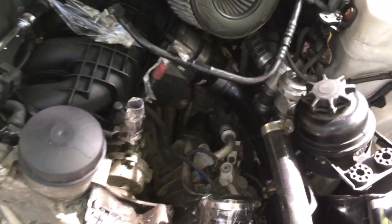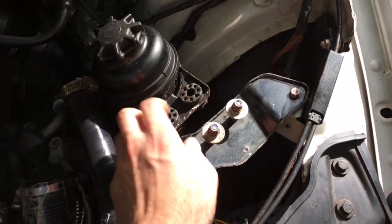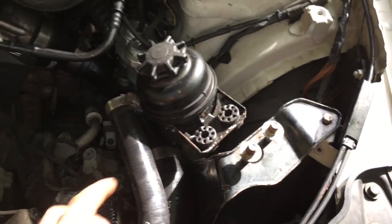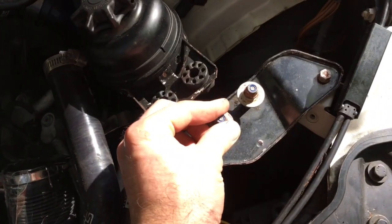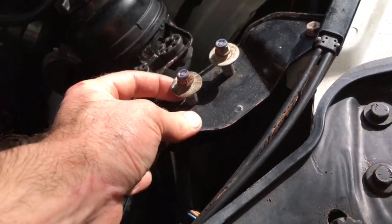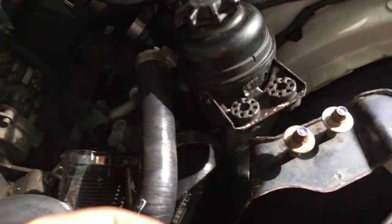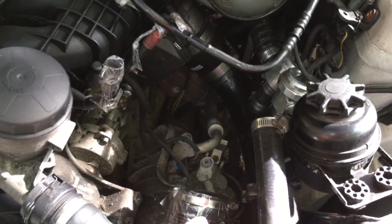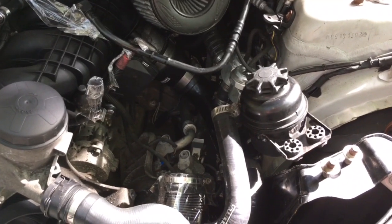You're not really going to be able to see what you're doing down there — you're just going to have to feel for it. I also took this off just to give it a little bit of room to move down there, because the hose is connected from this to the power steering pump. It's just these two 10mm nuts right here, and make sure you save the little spacers — put them somewhere safe so they don't fall out. It's also a good idea to go ahead and flush the canister and turn the wheel side to side to get all the fluid out of the rack as much as possible.